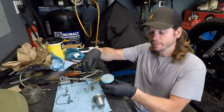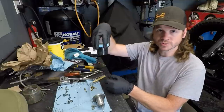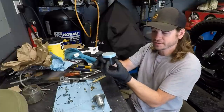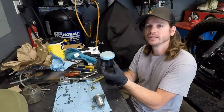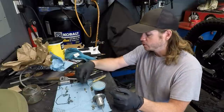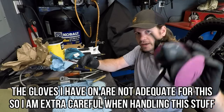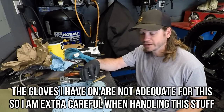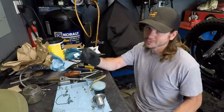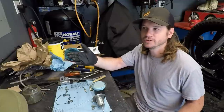So what I do is I put my brass inside this sealed container. I set this inside the ultrasonic. It stays sealed and isolated. And when it's in there, it's also being ultrasonically cleaned because it's just part of the solution in there, basically. So I'm going to drop these things in here, but you want to make sure you have gloves and a respirator. Now, muriatic acid will not hurt brass, so it'll be just fine. It'll clean it up nice, but don't put any aluminum in there because there won't be any to take back out. It'll dissolve into nothing.